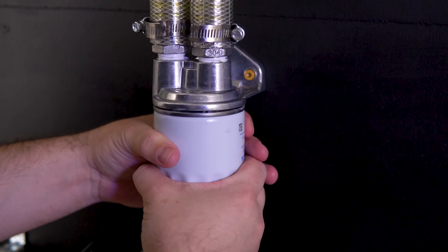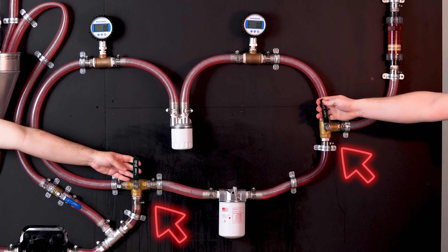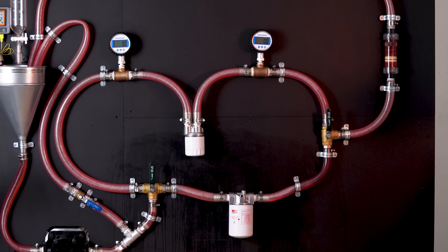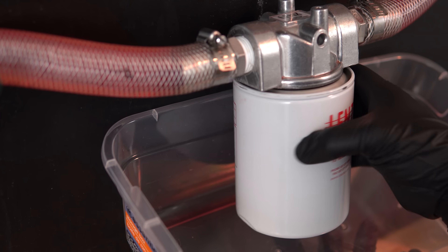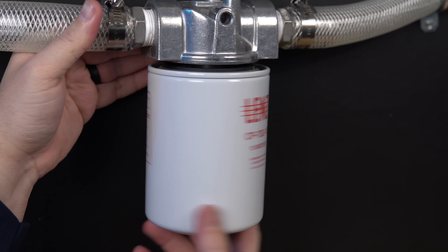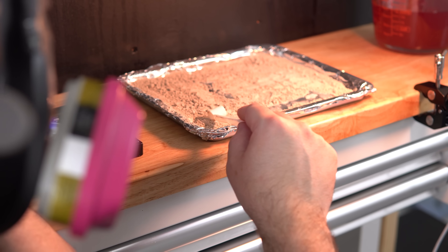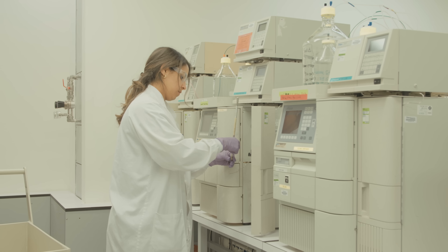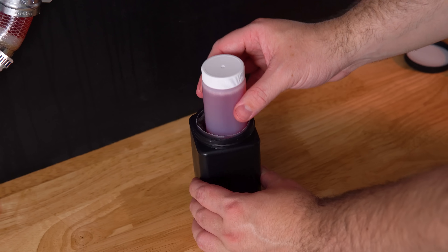In order to get a fair starting point, we installed a generic oil filter and ran 4 batches for a total of 4.4 grams of test dust, then utilized two ball valves to divert the flow to a secondary filter. We then ran the oil through this filter for a total of 30 minutes before every oil filter change. Just like the ISO test, this allows us to filter out and re-utilize the oil for subsequent tests. This filter is capable of filtering down to 10 microns — much finer than any of the oil filters we're testing — ensuring all filters receive the same amount of particulates above 10 microns. The oil laboratory will be performing an ISO particle count test. After running four batches through each of the filters, we collected the samples through our sampling valve, packaged them up, and sent them to the laboratory.